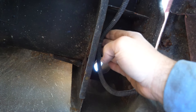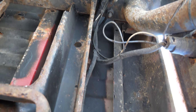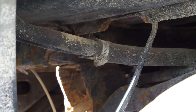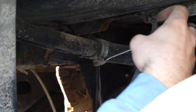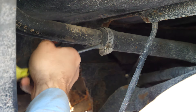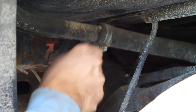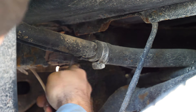On the underside, sure enough it is connected to the bed on both sides — if we pull this down, there's our connector, and it's connected on multiple spots here. Just disconnect those and make sure it's not connected to the bed before we move on. Next up we have to deal with the fuel filler neck. There is a little hose clamp here — we need to loosen that. I'll probably run a flathead around it. I'm going to be moving this tube anyway. And then on the other side there's a little hose that needs to get disconnected as well.